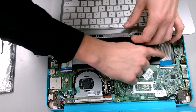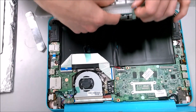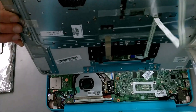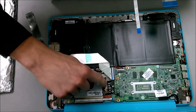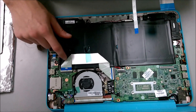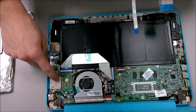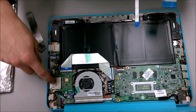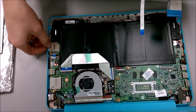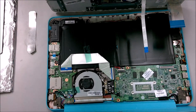The second one is the keyboard cable — that's the much larger one. Flip this clip up and it'll just pop out; that one's not glued down. And then you have successfully removed the keyboard. Inside, you can see you have your wireless card, the battery is in the middle, as well as a bus that runs to the other side for your SD card controller. And I believe this one here is for a SIM card — this is the LTE activated model.